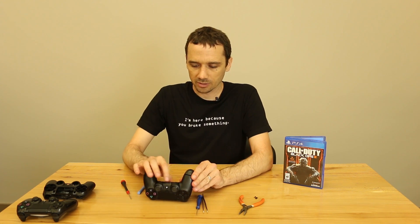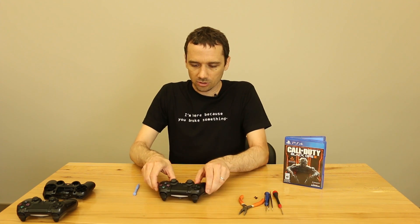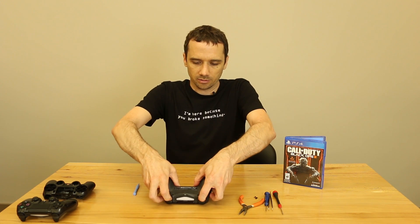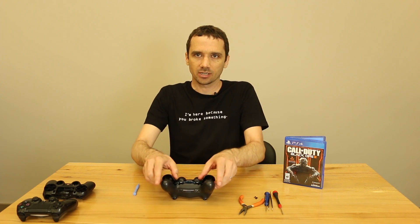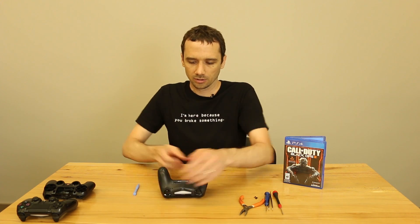After that, there are also two tabs here. After we get the case loose — you can see it's loose on there — it's not going to come up yet. So I'm going to turn it upside down and put my fingers right at the tops of these trigger buttons, and then pull the case this way. That one's not coming out yet, so I want to pull the case up like that. You can see there are these two long pieces right here — that's where the screws go down in. After that's done, that loosens it up so now I can pull this up.